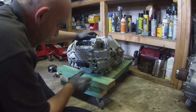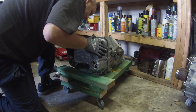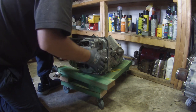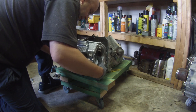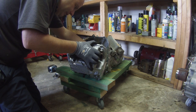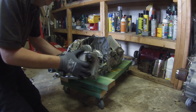We have now broken this guy loose. I can see in - looks like the supposition was correct. I can see the encoder connector here. We have also got temperature sensors. Unlike so many automotive systems, Tesla have actually left some little bit of slack on these so you can just disconnect them. Looks like they have used their favorite JST, but this is a different type of JST. Here it comes - inverter is off. Very, very straightforward.